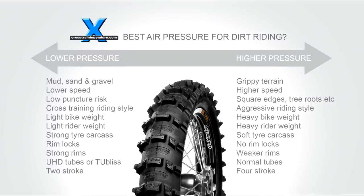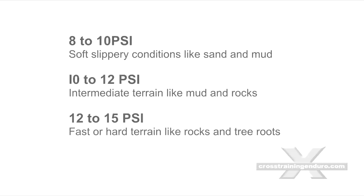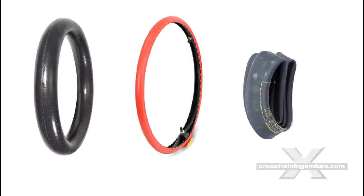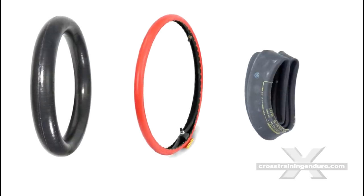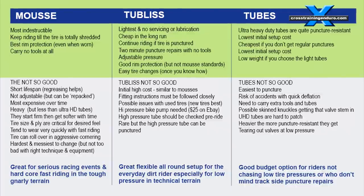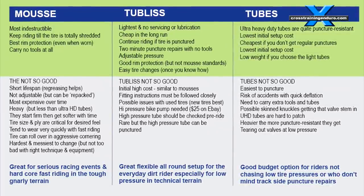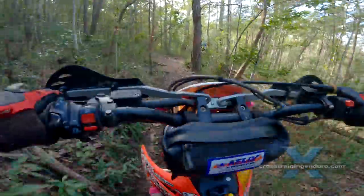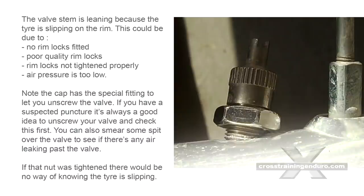Air pressures — there is endless debate about this. If you're using the normal thin tubes that come with new dirt bikes, here is a rough guideline. Fine tuning will depend on your weight, your type of tyre, and whether you are using heavy duty tubes. Apart from heavy duty tubes, you can also use the tubeless system or mousses. Generally racers and very aggressive riders will benefit from mousses. Tubeless is a handy way to get similar benefits with more adjustability, but not quite as bulletproof. See our video comparing tubes, mousses and the tubeless system. If you do run tubes, make sure you don't over-tighten the rim lock bolts — if your tyre moves, the tube can suddenly be ripped apart.